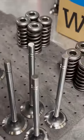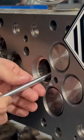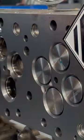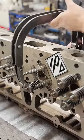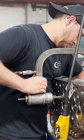After recutting all the seats, we lubricated the valve stems and assembled the head with the new IPD parts using our pneumatic valve spring compressor. If you're wondering whether or not we were actually able to improve the valve seat runout, the full video of the results is live on our YouTube channel now.